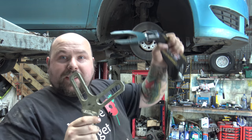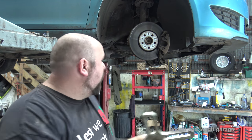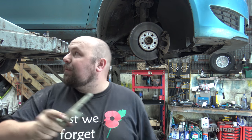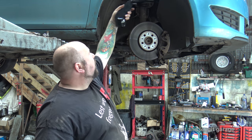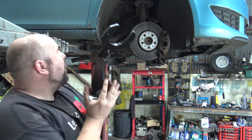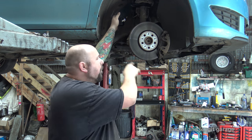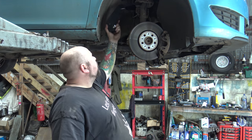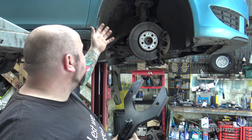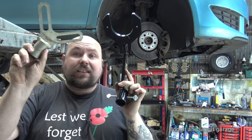We're going to show the WW3200 as well, because after I use the Strutmate I'm going to lift up the suspension level and tighten the wishbone down. The problem I've found with the transmission jack sometimes is that the bottom of the legs gets in the way. So what I'm hoping is that with the Strutmate, because I can put it to one side, I can get the transmission jack out of the way a bit. All I'm doing with this is not compressing the spring — I'm just supporting it, stopping it from dropping down, making it harder to get the ball joint in the wishbone. I have a feeling it's going to work absolutely lovely for that. This is designed for when you're on your own, because you need these little things to make your life so much easier.